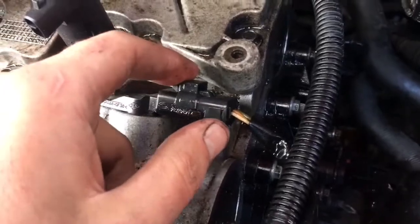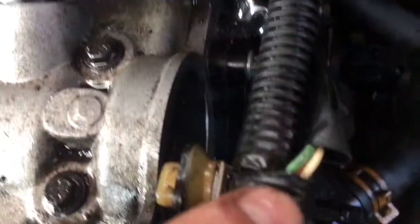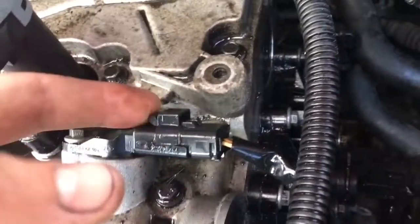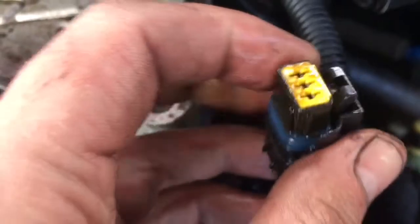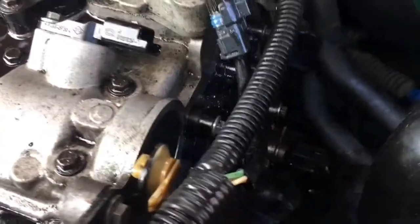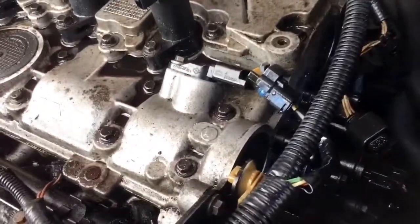And here - this might be the source of the oil. That's supposed to be white but it's gone yellow. As we can see it's nice and white there, so if we unplug this sensor - that's engine oil. I would say that is where our oil's come from. So I'm going to go ahead and get this replaced as well. We'll have fresh o-rings here and here, I'm going to swap this out, and I'm going to continue to degrease the entire engine so if anything does ever show its face again we'll know exactly where it's coming from. I've just been and picked some of our seals up and I'm getting the manifold ready to go on.